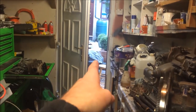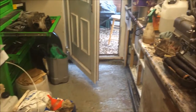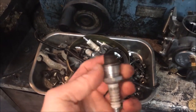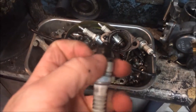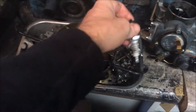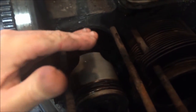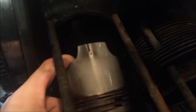I've got a load of other carburettor parts in the other garage. The plugs that came out of it were bad because I hadn't had a gas analyzer or emissions machine to set the carb up correctly, so it was running a bit rich. These are the pistons - they don't look that bad. There's no excessive scoring where you'd see faded patterns on the skirt of the piston, it looks to be okay.